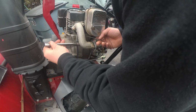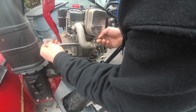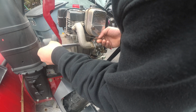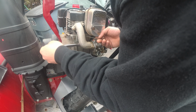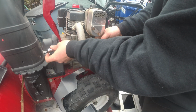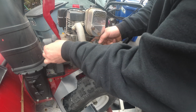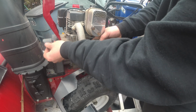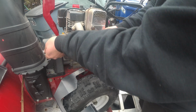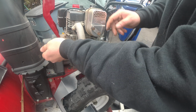Use the ratchet so I could twist this by hand. And you could just feel it. So what I'm doing is I have one finger behind the nut and I'm twisting this by hand, hoping it'll catch. Because that's why I try not to use certain tools for certain things. If you're using sometimes a ratchet or an oversized or an overpowered tool, you'll never feel things catch. You'll never feel things not catching or hard to catch, and therefore you know you're stripping something.